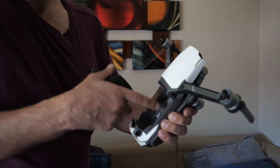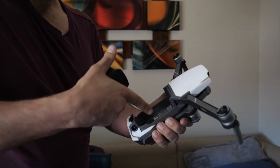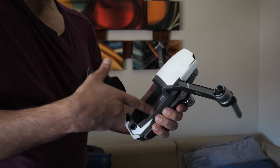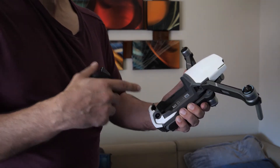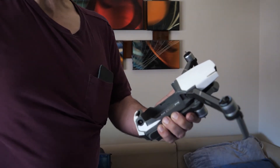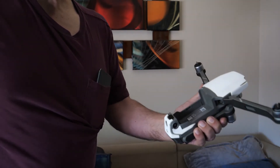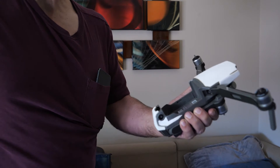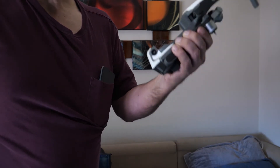That's how I know an airtight seal was created and that my battery was fully protected. So what can happen? Well, if you fly for just two or three minutes in a good rain — not a drizzle — you're going to get water inside the battery connector. And when that happens, your drone is going to drop right out of the sky. It's not going to give you any warning, it's just going to drop.